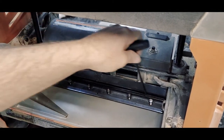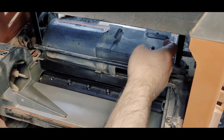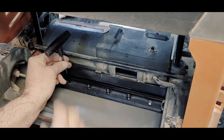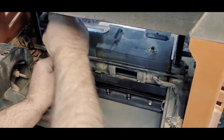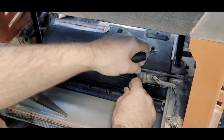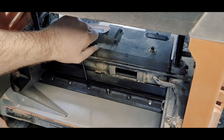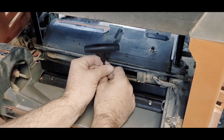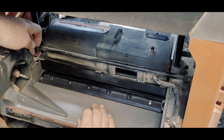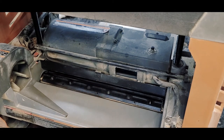Whether you're a mechanic or technician or not, I like to work from the outside in when tightening. You don't have to kill them — it doesn't take much. Just snug them in real tight, because like I said once it heats up they'll expand — kind of like an oil filter, you want a little tighter than an oil filter, but you definitely don't want to over-tighten them. If you look in the manual there might actually be a torque setting. Once you've got all six done, push the button with it still unplugged and rotate to the next set of blades, feel it click in, and you're ready to change the next set.